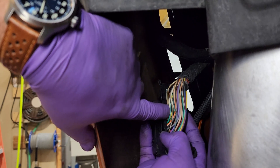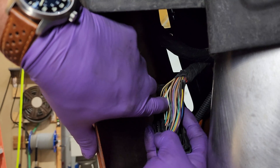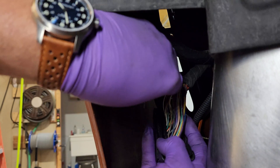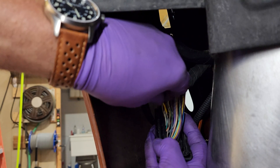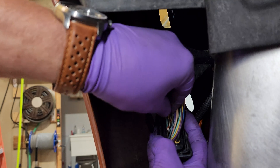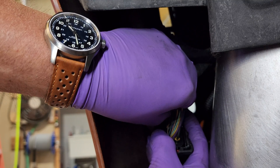There's a yellow wire sticking up right there on the second row, and then there's a blank or two. Ours is going to go between there. Our wire is typically yellow as well — so yellow next to yellow. It's probably not going to be the same on all ECUs, but you'll just slide it in like this and it'll click or snap in, and that will be done.